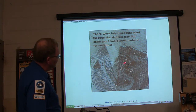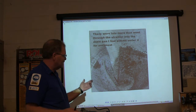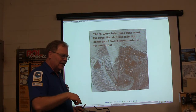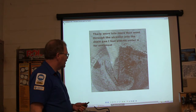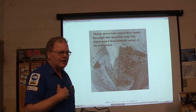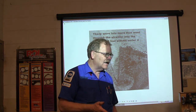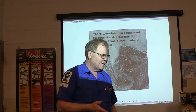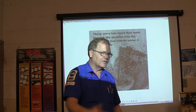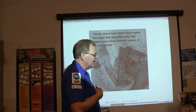This is a paint strainer, like what we did with the radiator on a lady's Nissan. We left the parts washer running and pushed fluid through the transmission cooler with a paint strainer and wiped out a lot of crud. If you ever have one where the splines in the torque converter are wiped out, the smartest thing you can do is replace the radiator too. Even if you're putting in another transmission, flush the lines, put a new radiator in, or put an external transmission cooler on it — because you don't want this trash getting back into your valve body.